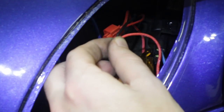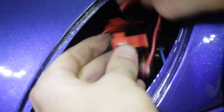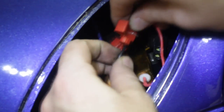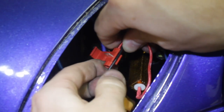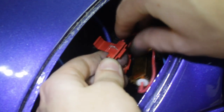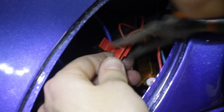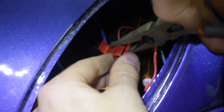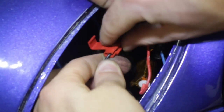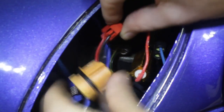So this is our negative side. Again, we're going to line them up there and get our other splice, and you can see on one end it's stopped off — there's the stopper on one end. Just push it through as far as it'll go, and then put it onto the black wire. Same procedure here. Just make sure the black wire gets in that groove on the quick splice. Make sure we're pushing that braided wire as far as it'll go, and then grab your pliers and firmly press down on the metal to make the splice. Once we make that splice firmly, we are going to check just to make sure it's in. We'll pull on that braided wire to make sure we snagged it, and then look at that metal piece. Make sure the black wire is fully spliced, and then clip it up and we're ready to go.